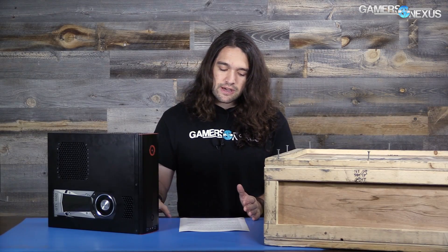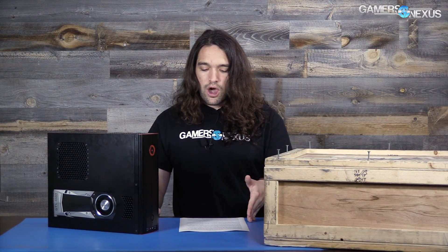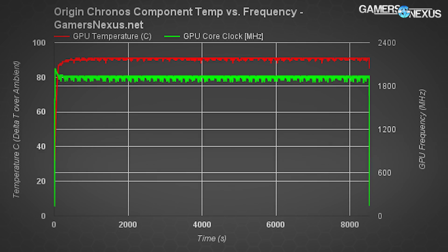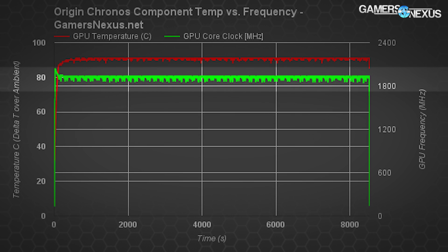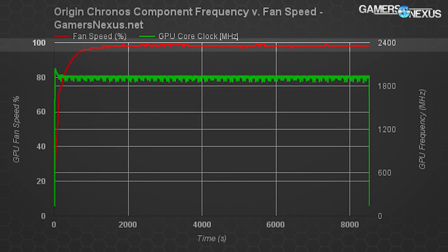This can be partially resolved. We ran a two-hour endurance test using Metro Last Light to see how it responds to 1440p with max settings — it's a bit less clock-biased. The test was conducted with the pre-configured overclock and auto fan speed settings. The GPU temperature versus frequency versus time chart shows frequency is more stable here; we can sit at about 1900 MHz, though we can't maintain 2000 MHz. The temperature shown is the actual GPU diode temperature with ambient added — we're at 90°C here — and the only way to achieve clock oscillation stability is to allow the fan to auto-boost up to 100% speed, or 4000 RPM. That obviously impacts noise.